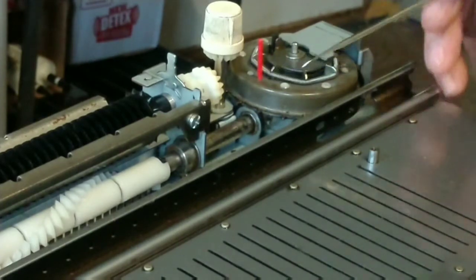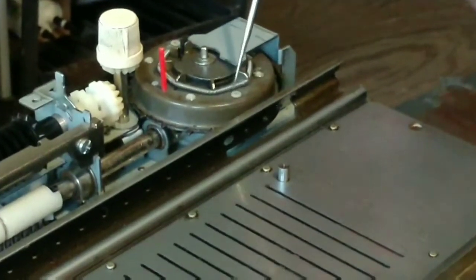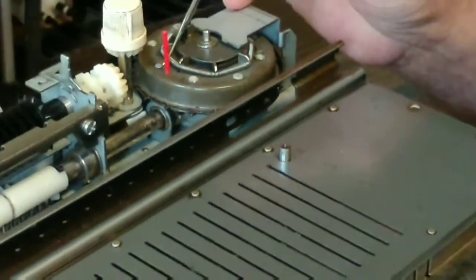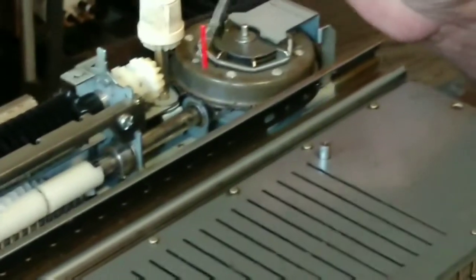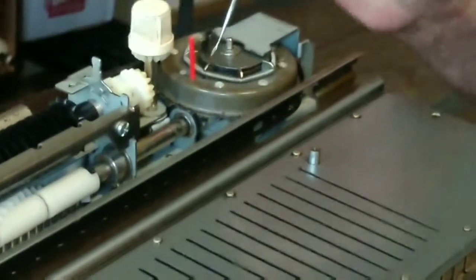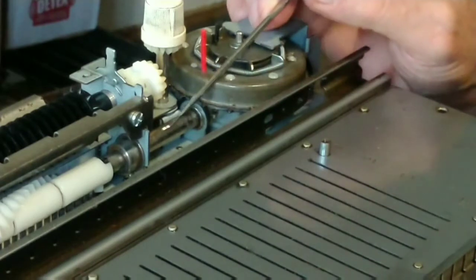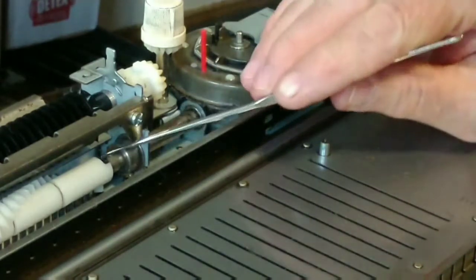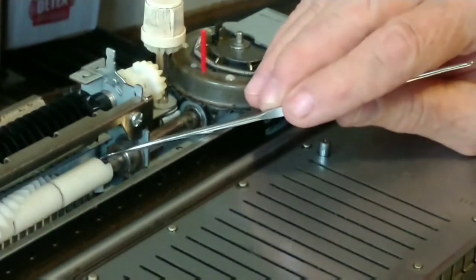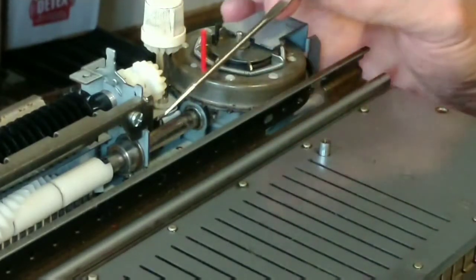If the camera can move in a little bit, I want to show you what it is not. It's this hole which is in one of the plastic clips in the top — there's a hole there, yes — but this is actually a hole in the surface of the drive cam. At the end I'm going to pull the straw out so you can see it's just a hole. That hole lines up with this rod, and that means it's lined up with the flat of this cam when the cam is straight in a horizontal position. So the flat is looking up, and this is facing that flat.